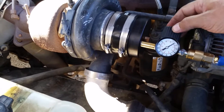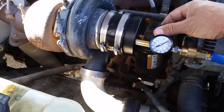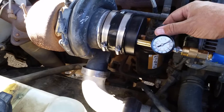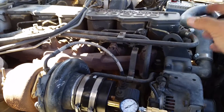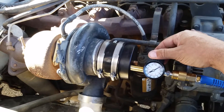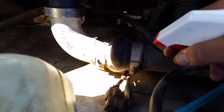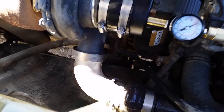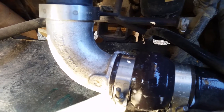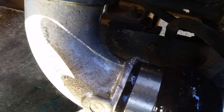I'm not sure this won't come apart. You're going to hear a leak going into the engine and through the valves. Somebody said if you turn it to top dead center that stops it, but that's not true because not all the cylinders are at top dead center. You're supposed to take the intake off and plug it, but my leaks are so significant at only 10 psi that I'm just going to stop there.